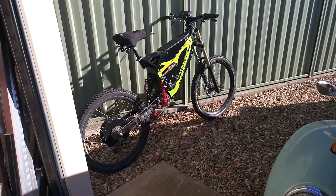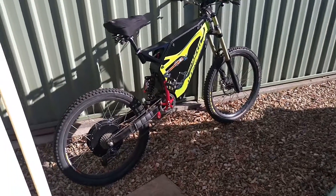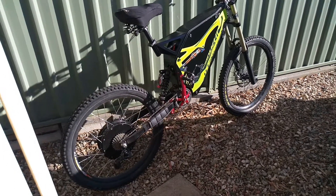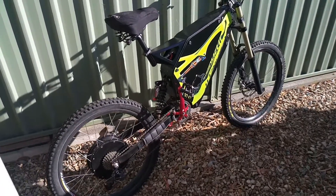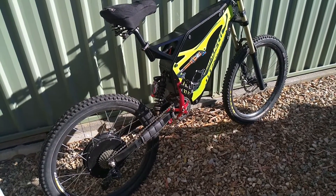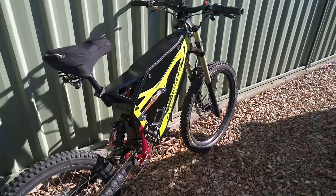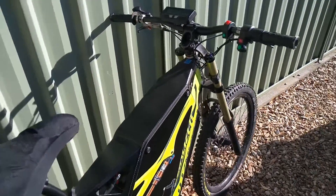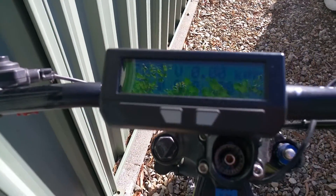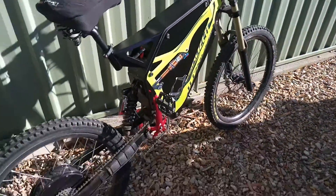The bike over here is just a bit of fun — we've got a few of these. This bike is running 60 18650 2 amp hour batteries in series-parallel, so it's 80 volts, 6 amp hour. You can see it's not quite charged, but it goes great — a lot of fun.